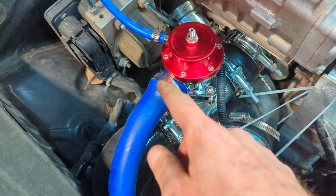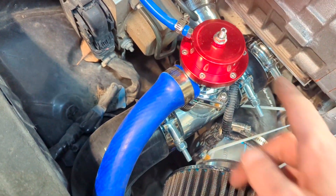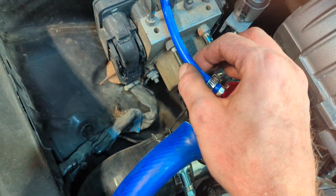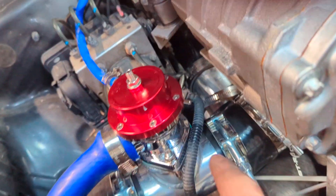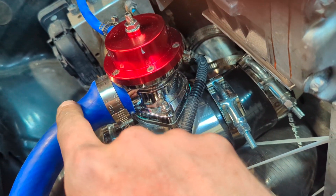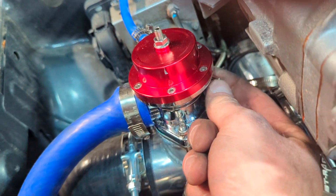Here's the recirculating blow-off valve — the hose takes quite a circuitous route around, down, and then finally up to that fitting. It ended up being very tight, so sending a hose straight this way would have immediately kinked. It has a port intended to see either boost or vacuum, connected to this formerly capped port on the intake manifold. It also has another very small port that I need to plug — this would basically act like a leak, letting in a bit of unmetered air. I'm not sure I have a plug small enough for this, but I'll figure something out.